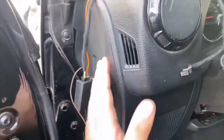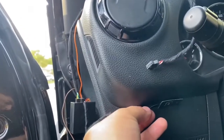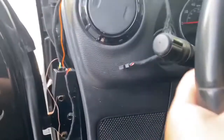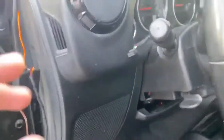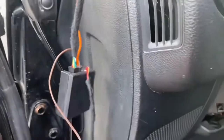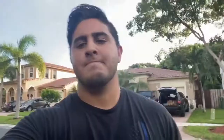Something I recommend is that you go ahead and put the harness on the dash and kind of lay out what you want to do. So the module I'm going to hide back here — there's a good place where I could zip tie it. I'm going to have the actual switch down here so it's not visible. When I'm driving I can just reach for it right here and it won't bother anybody. The ground connects to the chassis, and then the power I'm going to run all the way through the battery — there's a hole in the firewall right over there.